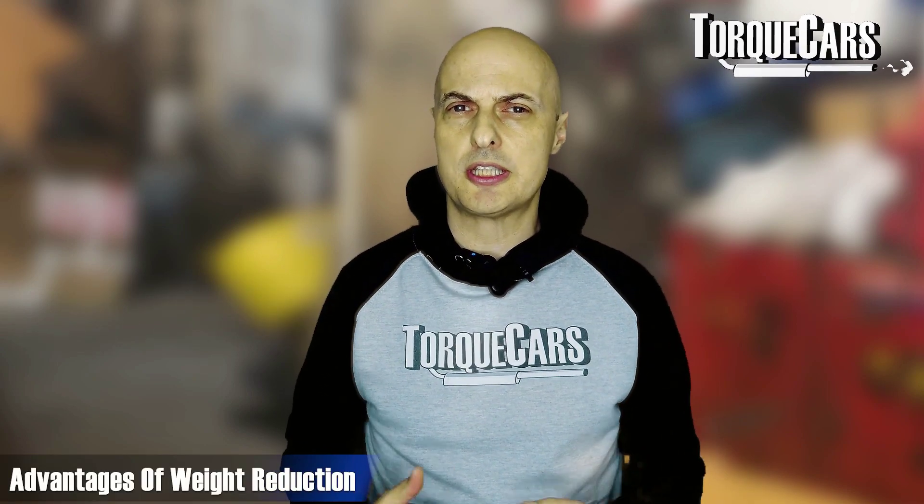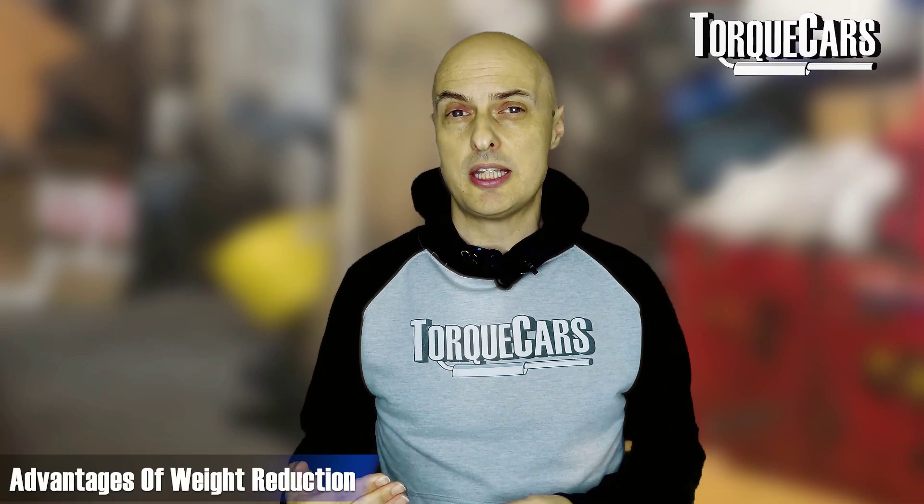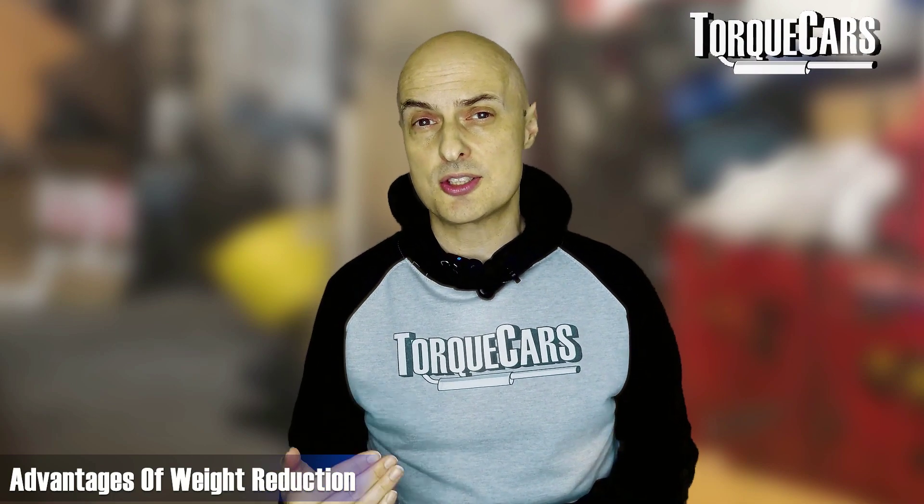When upping the power on an RX7, you should really start with weight reduction. Weight reduction enables the car to handle better — it improves braking, acceleration, and cornering, and it's a fairly cheap mod. You're just stripping out heavy items and replacing body panels with lighter alternatives. Carbon fiber and fiberglass parts are available in abundance for the RX7, and some of them look particularly stylish, though there are a few tacky ones — taste is your call.